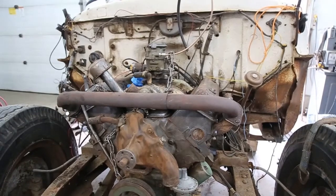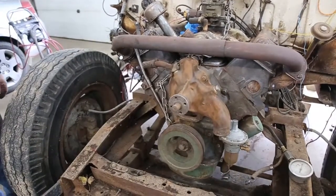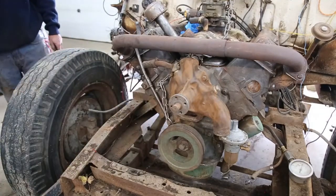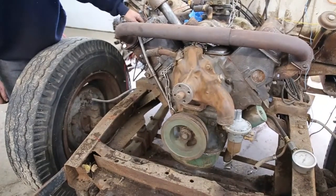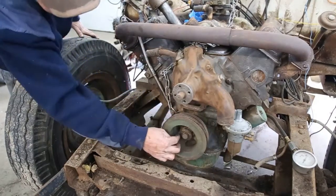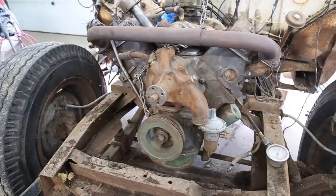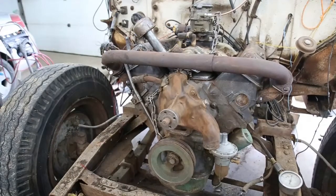So there we go — a success story from an old throwaway truck. We better replace this though. Why are we replacing that? Come over this side — oh wow, is that ever crooked. Looks like somebody dinged it. Looks like the front pulley was hit, so we're gonna have to replace that. It's the balancer — they probably put a jaw puller on here instead of the proper puller on the front. That's obviously not the right way to do it. This has happened many, many times, so keep your eyes open for little things like that — it could potentially be quite dangerous, and it's really easy to fix when the engine is out.